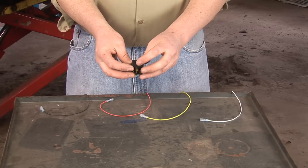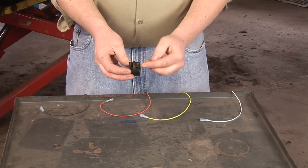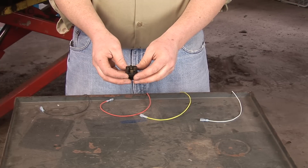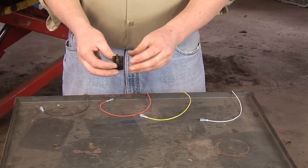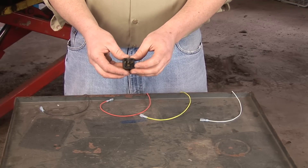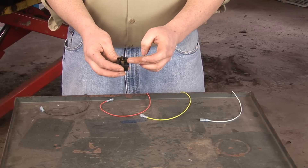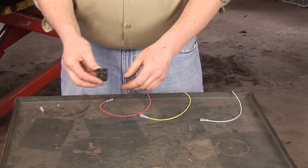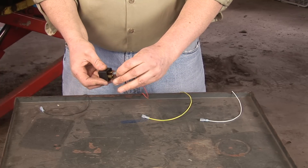The pins referenced in this diagram are also molded on the bottom next to the corresponding pins. The first thing you need to worry about is your power into the relay. That goes to pin 30, which is the pin that sits by itself over here. We will hook up our power to that pin.